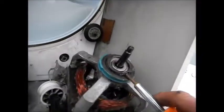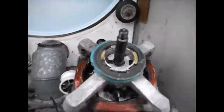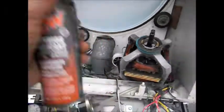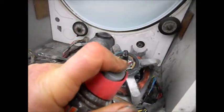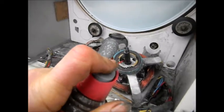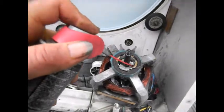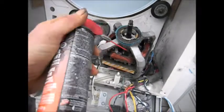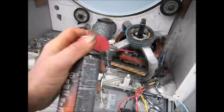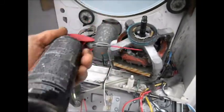You can pry the bearing cap off, take that cap off, and look in there — it might be kind of dry. So basically what we're going to do is take some of this and spray a bunch in here, make sure that shaft is nice and loose. Then we're going to do the same thing to the other side, try and get all this gunk out, any of this excess lint. Take a good brush or blower and blow that stuff out.